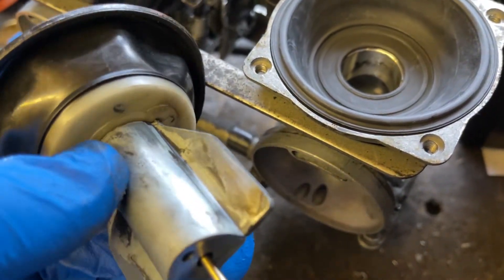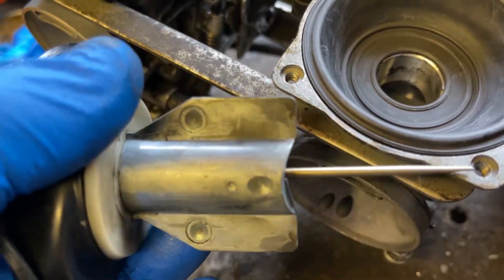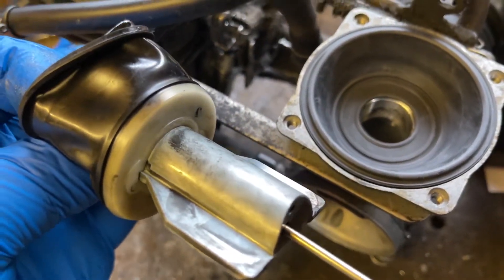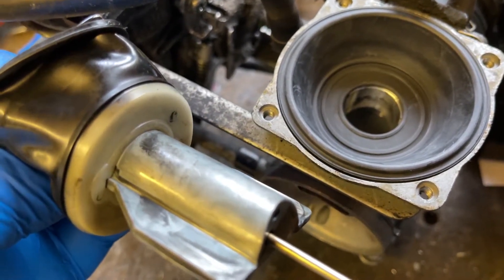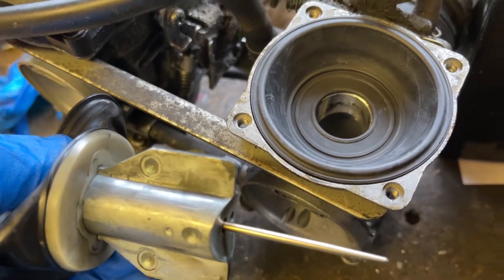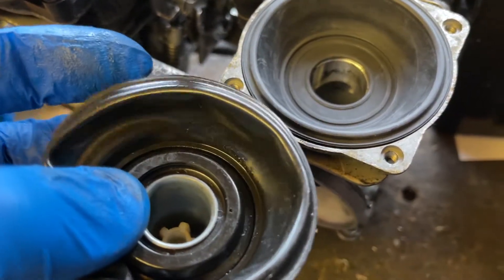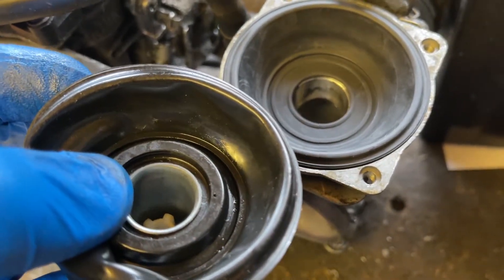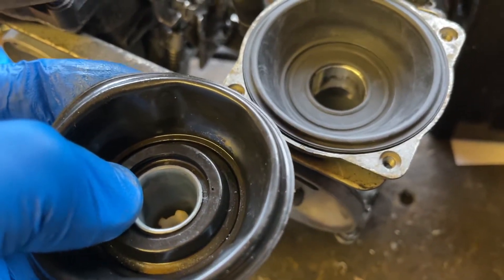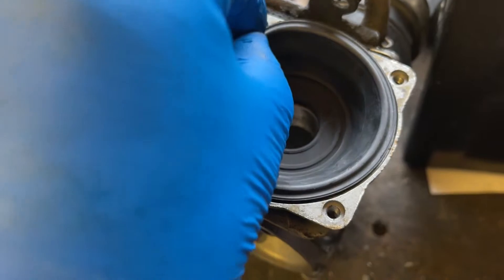I've got to be honest with you, I put E10 in, and it's had three tanks, and it's slowly got worse. I suspect, for those that know the awfully complex fuel tap on the ER5 and the GPZs, that I'll come across the same with the diaphragm that's actually in the fuel tap. But yeah, I'm rebuilding my carbs. What you can see there is just a quick confirmation that it looks as though it was the E10 that's taken them — these have lost all their shape. They will not fit very easily within the grooves at the top of the carburettor.